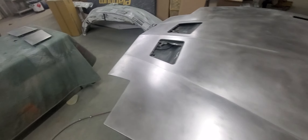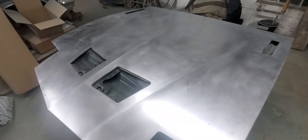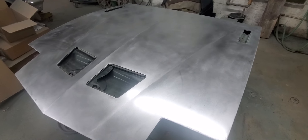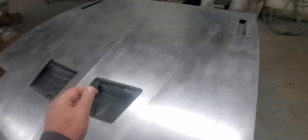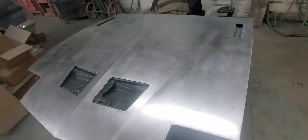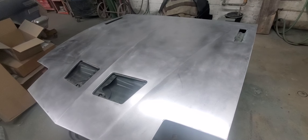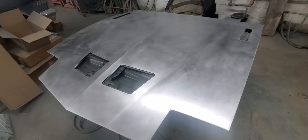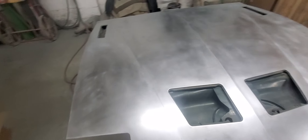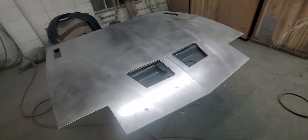I had a guy who does some work for me come up yesterday and stripped the hood for the '92 Trans Am. This was the only part of the car that really had any paint problems — it had developed tiny little microscopic cracks in the paint. It's factory paint that had just gone bad over the years. The rest of the car is totally fine. You can't just sand it down, prime, and paint over it — it would look good for a while but it'll always come back through. If you're going to fix something, you have to go back down to the foundation.